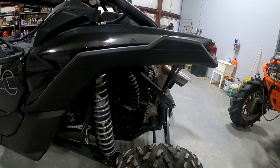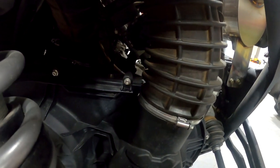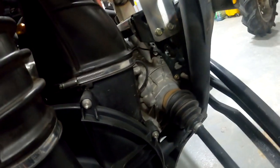I'm going to get to taking this clutch cover off and go over the steps of how to pull the primary off. I've got a nice little trick for doing that — maybe you've seen it, maybe you haven't. If you use grease, you're not going to want to after this. Side note for 17-to-19 X3 owners: the factory clutch cover bolts are T30 Torx, just like everything else on this machine. That sucks because they always strip out. If you hop on Rocky Mountain ATV, follow the link from our parts store, and get yourself some model year 2020 and newer X3 clutch cover bolts — they're both 8-millimeter and T30. Pretty neat, real cheap, and it'll save you a lot of headache.